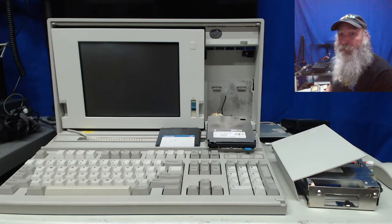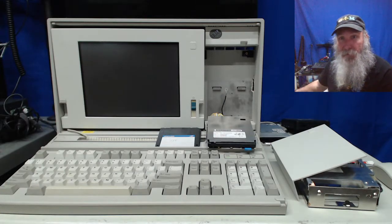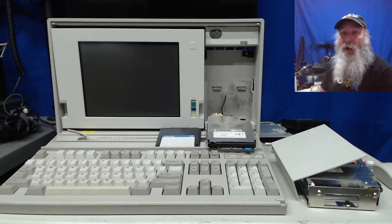The first unit I tested is really interesting — it looks like it's got about 32 MB of RAM on it. It has a memory adapter by Intel; I've got others of those. It must be a 32-bit version. On all the units I've seen, the SIMM sockets are populated on the board, which is very common. I've got a lot of those 2 MB 85 ns 72-pin SIMMs that are really common for the Model 70s and the P70 units, as well as some memory expansion adapters.